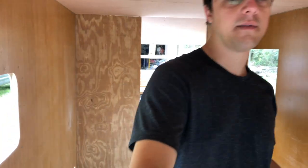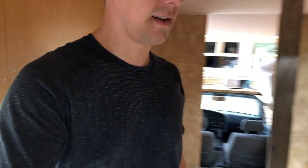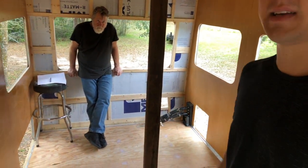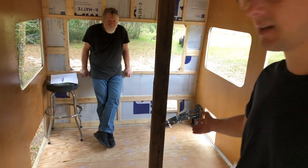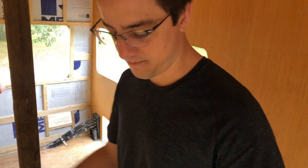Today we're getting ready to start the floor install. We decided to go with all-natural Marmoleum flooring from Forbo. It's all natural, so you don't have to worry about off-gassing in a small space like a camper — that's something you have to consider when thinking about flooring, adhesives, and foam insulations. The floor comes in a 79-inch width, which is basically almost our exact width. We'll need to trim around the fender wells, a little around the fuel location, and then have some overlay on the front cab area.